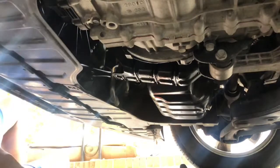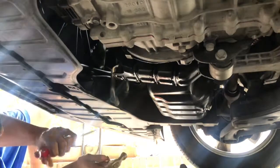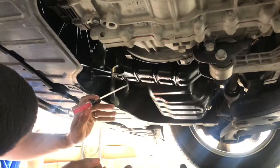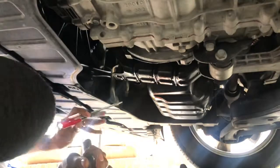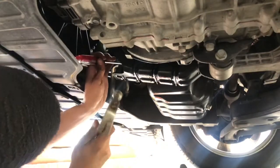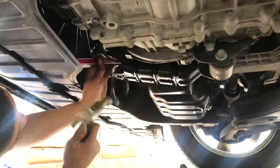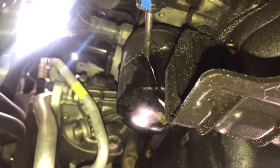This is what I was telling you about — you have to get the screwdriver and the hammer. My dad told me this: you're not going to break anything, you're just going to get this old oil filter out. What I've done is punched the screwdriver through the old oil filter because it's hard to get off since it was hand-tightened.